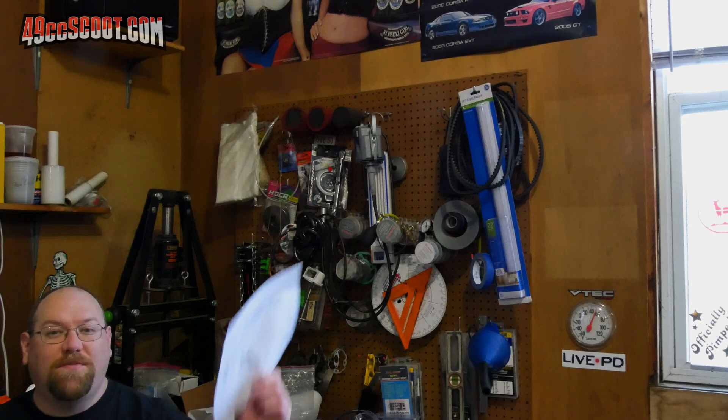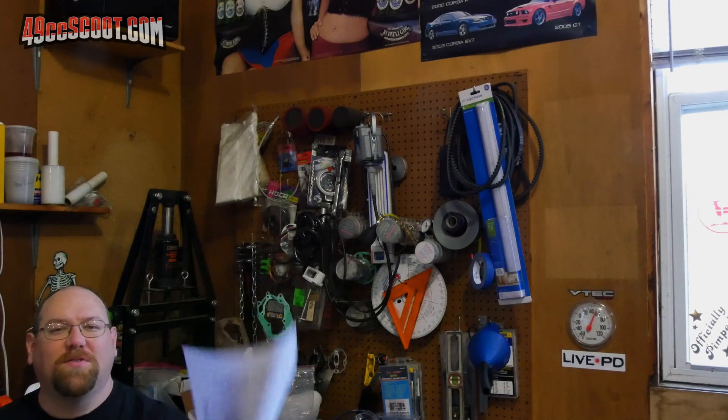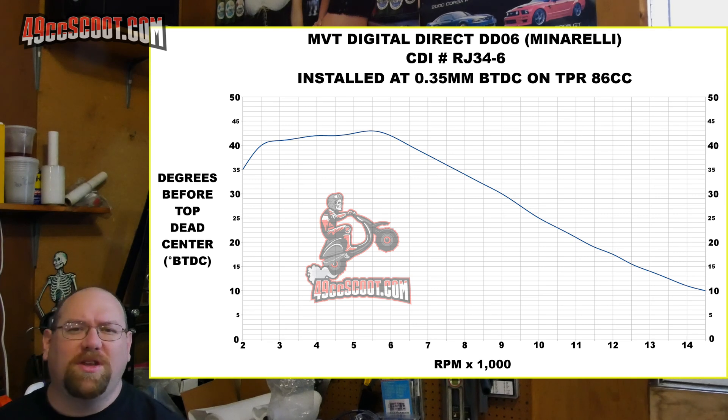Finally, after five timing lights, two tachometers, and a custom-made timing indicator, we can actually watch the ignition retard the timing as RPM increases. I couldn't do it by just watching it live, but I did finally get a timing curve map made up that I'll put on the screen and also post a link in the description so you can download it at full resolution. What I had to do was sync the videos up and then watch frame by frame to pick out different timing points, because the light flashes so much and disappears so often that you really have to scrutinize the video.